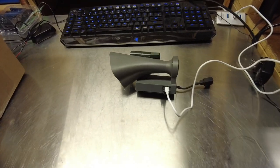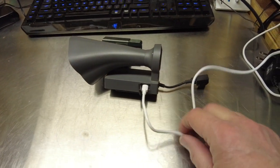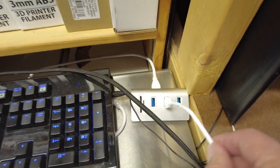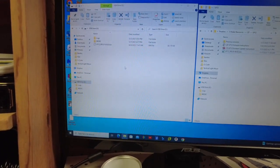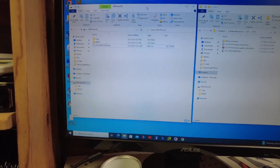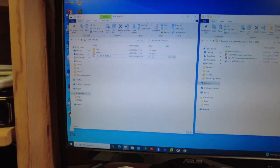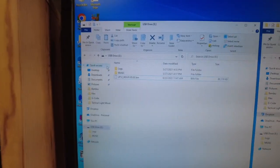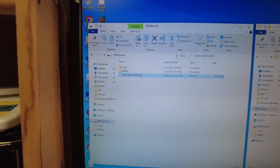I'm going to show you how to do this on a Windows computer. First, connect the LP12 via micro USB cable to a USB port on your computer. In Windows Explorer, it showed up as the eDrive in my case — I've clicked that open and it looks just like a thumb drive. You can see the window here on the left — there is firmware sitting on there right now, along with two other folders.